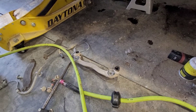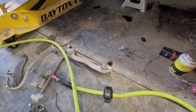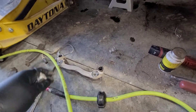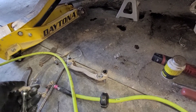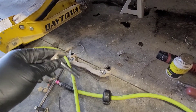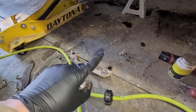One of them will get stuck because they're not properly lubricated. Water gets inside these channels where the slide pins go and causes them to seize up. What is a caliper slide pin? These guys here are caliper slide pins. They float inside the caliper bracket and actually allow the entire caliper to float inside this housing, which allows for a little bit of flex during normal driving. When you let off the brakes, the brake pads never actually retract completely off of the rotor - they kind of drag a little bit, which is normal. There's nothing that actually pulls the pads off of the rotor; it's just a matter of how much pressure is being applied. These slide pins are crucial in allowing the caliper to properly float and flex with daily driving, so your pads don't get hung up and start gouging into the rotor, which is exactly what happened on the driver's side.